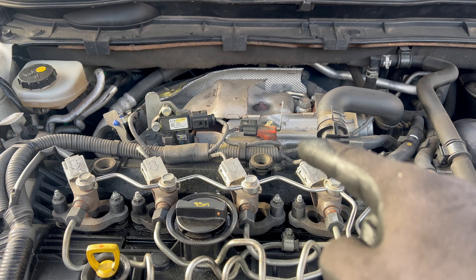Here is the new exhaust pressure sensor from Mazda — genuine parts. Here's the sensor itself. As I said, it is a metal one, so the nipple of it is metal. On the old one they are plastic. You need an adapter wire, so don't forget to put that back. There are also two clamps for the rubber hose, the bracket, top and bottom bracket, and two nuts.